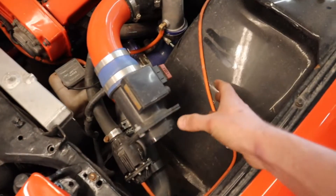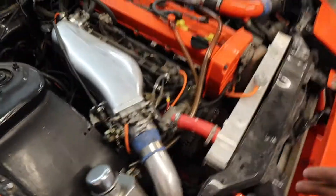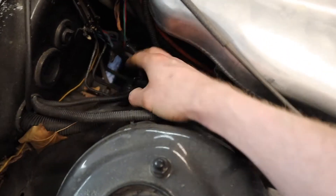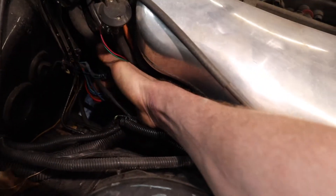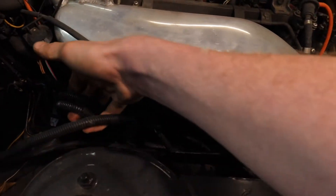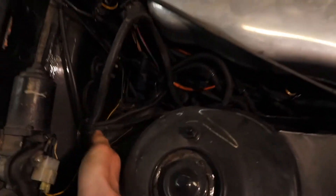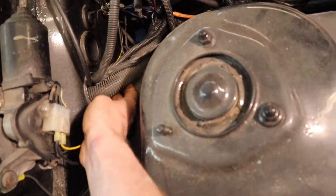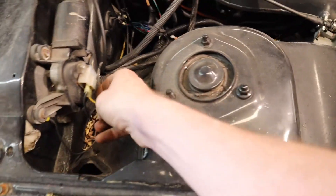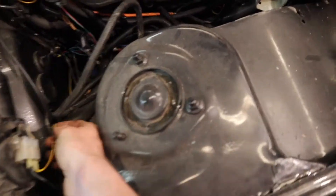There was no filter on it, it was just kind of chilling. This is the RB20 stock wiring harness, somebody's just kind of slapped it in there. When you see wiring like this it's disconcerting — this is bad. Anytime you have a wire going through a firewall you should have a grommet on it. Without one it will chafe, cause a fire, cause shorting. The wiring harness for the wipers goes through the engine harness — somebody just ran wires through the firewall.